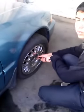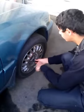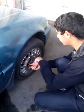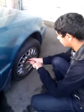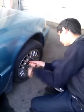Once you've got all these things, you should head over to the tire that has the issue. If you take the bolts off all the way before jacking up the car, then the tire will fall before you lift it up, so that'll be an issue.